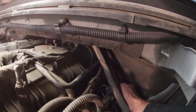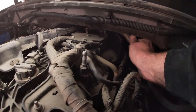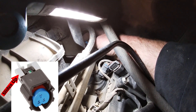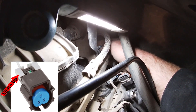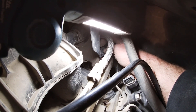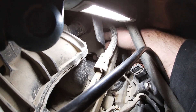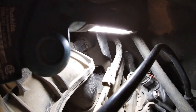We'll just bend that out of the way so it stays down. I just tucked this hose up underneath there to give me a little more room to get my hand right back in there and get to the sensor. I fought the sensor clip forever — there's a little safety clip that goes over the clip itself. I ended up breaking it because it was stuck on one side. But once you get that little rectangle part slid up, you just push this button and the connector slides right off. Down through this hole where my finger's at, that's actually where the sensor is.